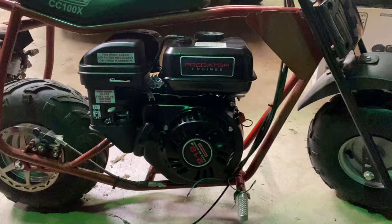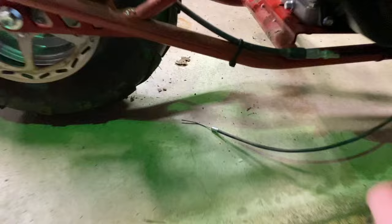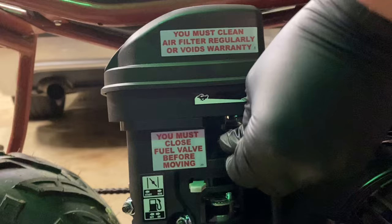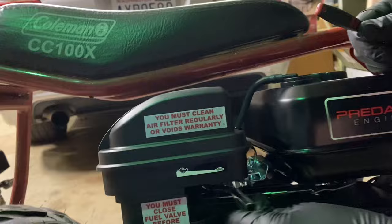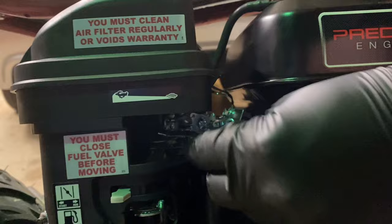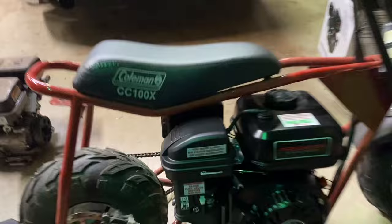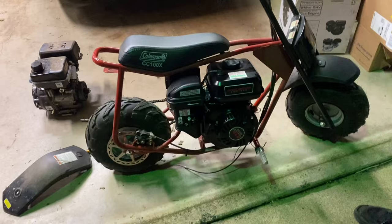Cameron is loosening the connections for the throttle to hook up the throttle cable. This is the throttle arm right here - it pulls this way to open throttle. When you first get the engine, the throttle arm is really stiff, so you have to loosen that bolt so it moves freely. Also be aware this is a lawnmower-style engine, so it's designed to rev at a certain RPM - that's why it doesn't make superpower without modifications, and you can get a runaway engine if you're not careful.